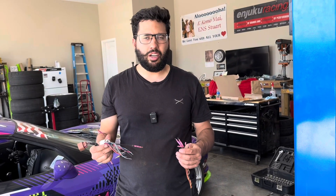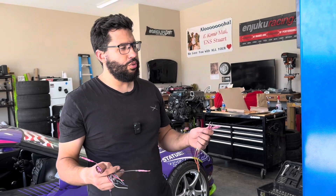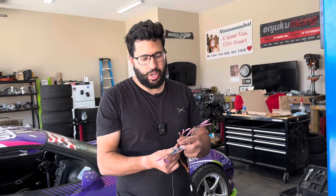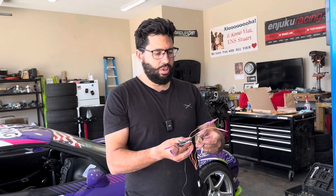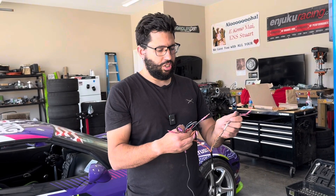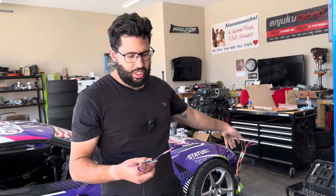The only wires I ended up having on the car: on the left is the drive-by-wire. The harness comes for a Corvette pedal, so if you have a chassis that's usually drive-by-cable, you could just get a pedal and it'll plug right in. But if you have a Z pedal, the orange wires are 5-volt power, the black with white stripe are the 5-volt grounds, and the other two — orange and yellow, and orange and green — are the pedal sensor signals, which doesn't matter which one you put where. It will learn it when you calibrate the throttle. The plug side on the 350Z is simple: power and ground are on the outsides, and signals are in the middle.